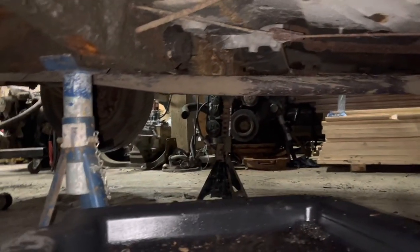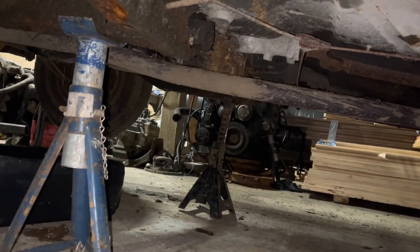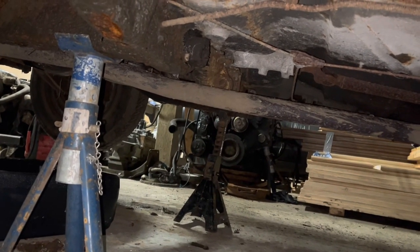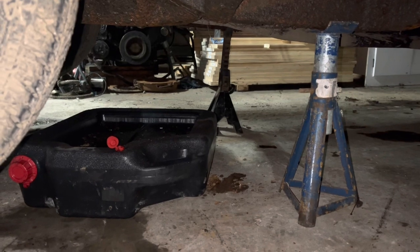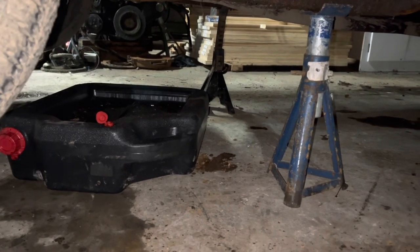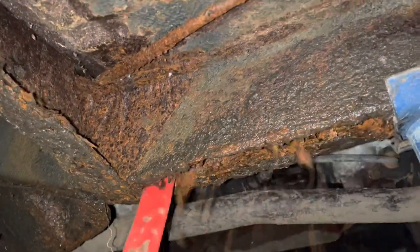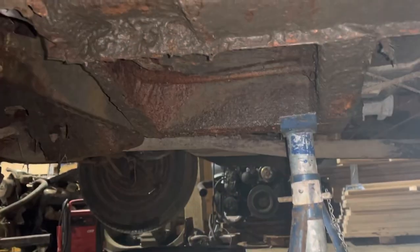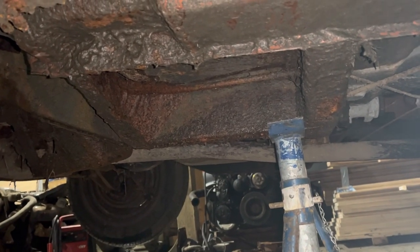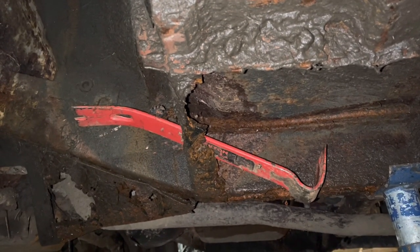I'm actually glad I didn't get this done — it gave me a day to think about things. I don't think there's actually room in an A-body to leave the crossmember in place and do what I was talking about. There would be if I cut the radiator support out, but my sawzall power is still gone. And I've decided to actually do the right thing and drop the transmission pan because I don't want to spend the next hour living in a lake of the stuff. Turns out this car isn't frame rails either — that's unfortunate. What is holding this thing together? Fear?